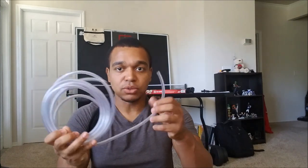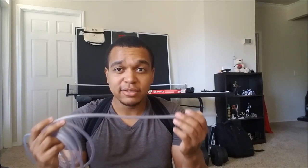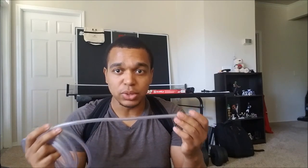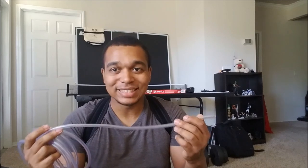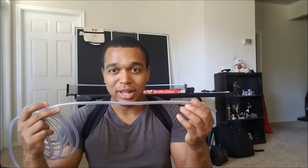You'll also need some kind of pliers or scissors to cut the tube line that you'll use to bleed the clutch by yourself. You also need some 3/8 inch or 1/4 inch tube — be sure to test out which one fits your slave cylinder, as they alternate between 3/8 and 1/4 that I've seen. You can get this from Home Depot or Lowe's. You'll also need a 9 millimeter socket and potentially a 12 millimeter socket.